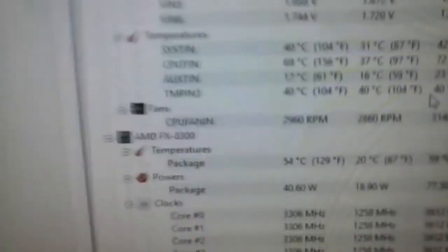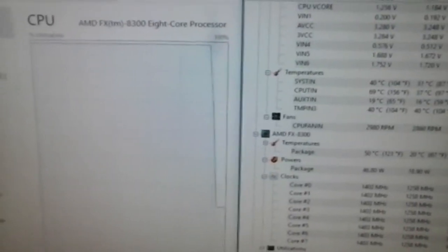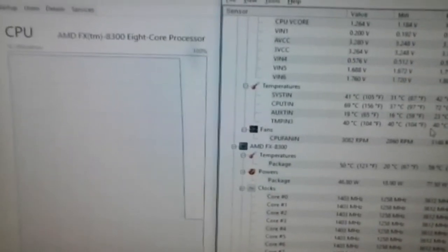Now I just remove the fan — wait a little bit. Look at the temperatures: 54 degrees. Wait just a moment and as you can see it throttles instantly. That's it. That is the reason why it throttles in my case — the VRMs or MOSFETs have no heat sinks. Sometimes even where there are heat sinks you need fans, but here there are no heat sinks at all.